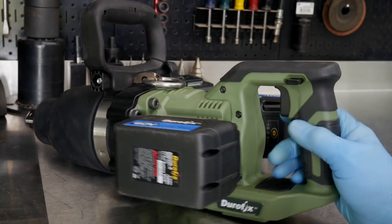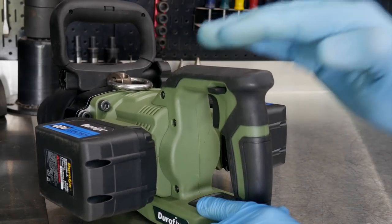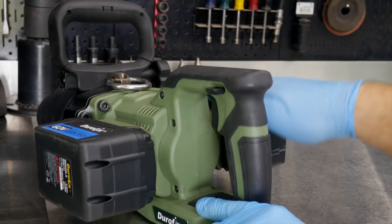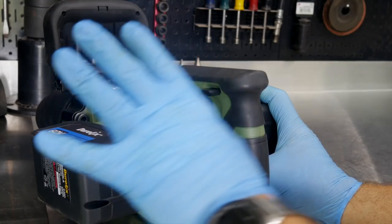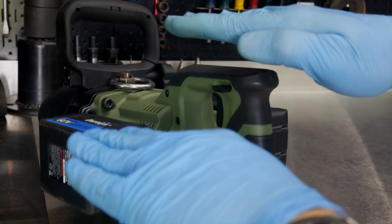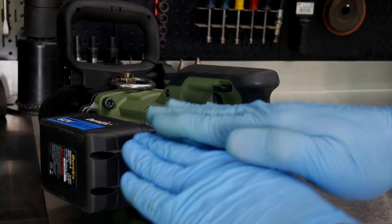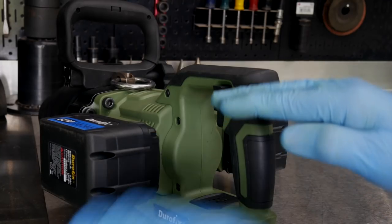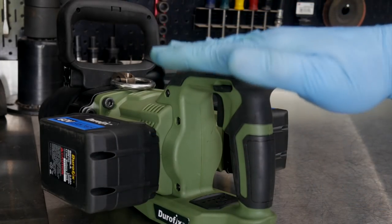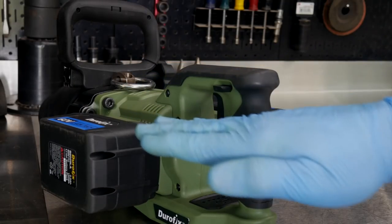When we put that on there, the PC board is going to realize which one has more charge. The one that has a higher charge, it's actually going to use that battery. The other battery is going to supplement it. And so that lower battery will continue to help out this one. As this one goes down, it continues to help the other until it's depleted. So you're always going to be using the higher charged battery.